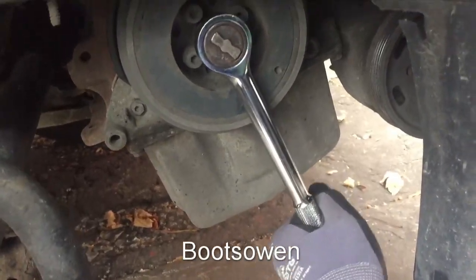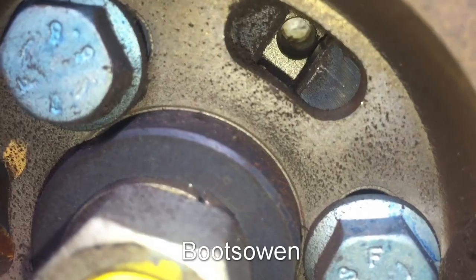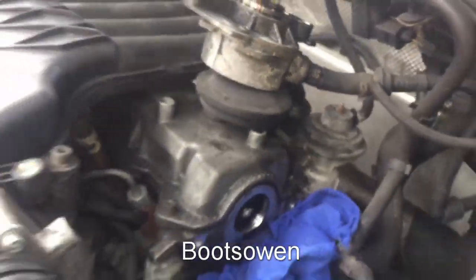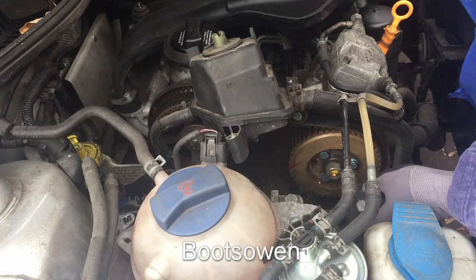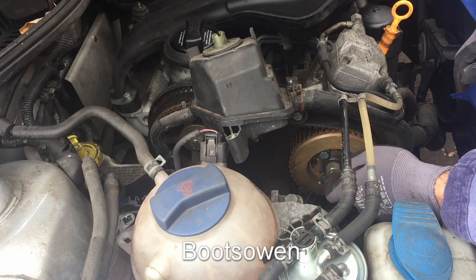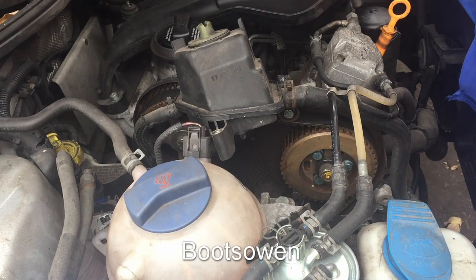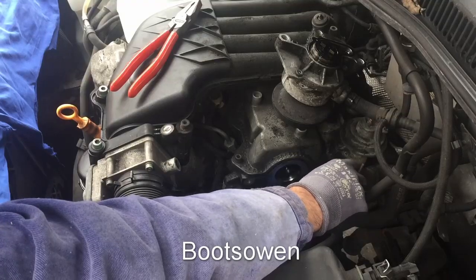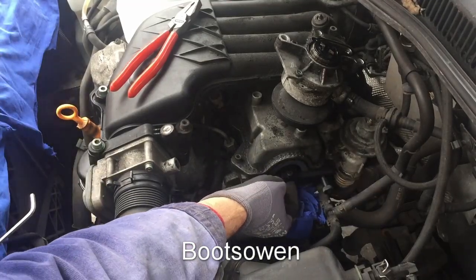It's not actually that hard to rotate. Up here on the diesel pulley in this slot on the top you can see there's a slot cut in there and then in behind there's a hole. What I'm hoping is when I go over this side this will be bang on to horizontal and it's not far off it. I think if I can get that diesel pin in we'll be right for locking it up. Yeah, wiggling with the pliers I'm sure it's going in. One of these pins in, and this should slide on. And that locks in perfectly.